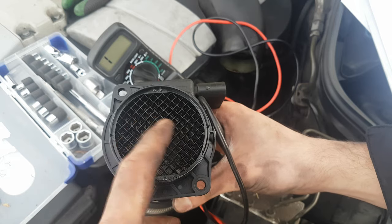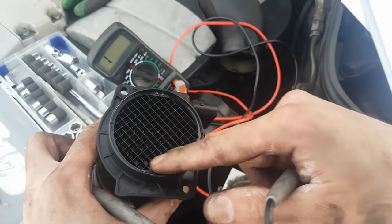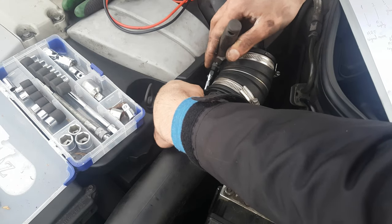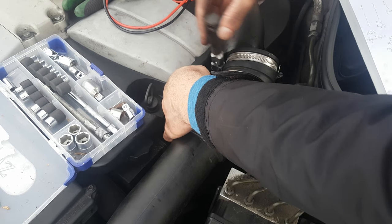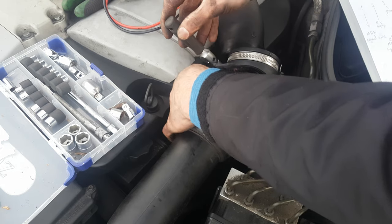By the way, there should be a screen over here in order to even up the air flow. The grill on the MAF sensor has the same effect as on a water tap — if you remove it, the turbulence of the air will make the engine run lean instead of increasing power. Also keep in mind that even if you get a mass air flow sensor code, that code doesn't mean the sensor is bad.